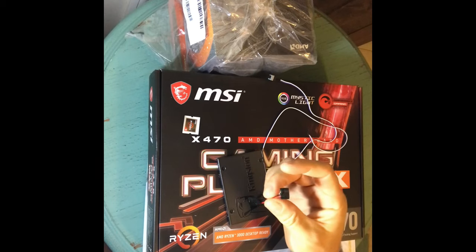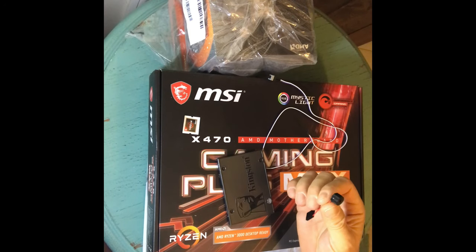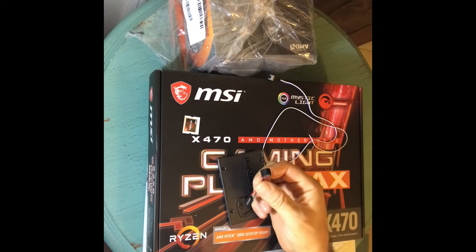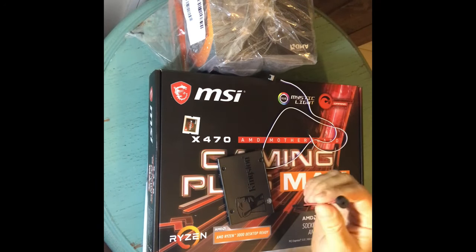I got the little speakers because with that Asus motherboard I had nothing — no LEDs or anything — and that would have helped troubleshoot my booting problem. It turned out it was the monitor. The monitor works fine every other time except when it's HDMI right into the motherboard — HDMI or anything on that motherboard, any motherboard.